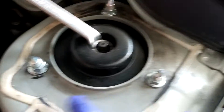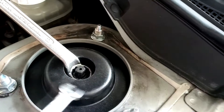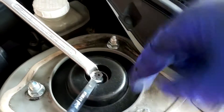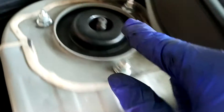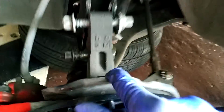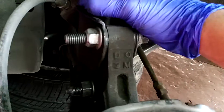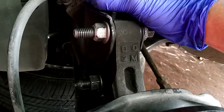As you can see I have it here — these nuts are 14 millimeters. Now you put the 17 wrench right here and with the 8 you're gonna grab right here, and then with the 17 you're gonna turn it to tighten everything. I finished tightening this and now I'm gonna put everything right here. Remember to put the brake line in its place with this clip right here, and with the jack I'm gonna lift the knuckle a little bit for the bolts to enter in the holes of the strut. I have everything ready to torque it — I'm gonna torque these two bolts to 115 pound-feet of torque and this one to 33 pound-feet of torque.